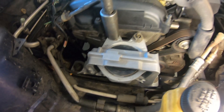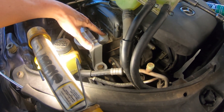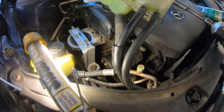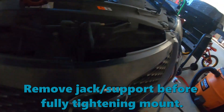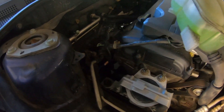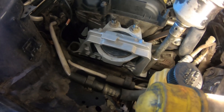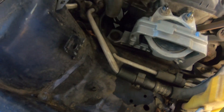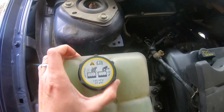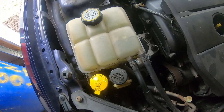Now we can tighten down these two nuts as well. When you do the front part you want to make sure these nuts are snug, or at least bottomed out. Then before we go wrenching on them we're going to remove the tension from the bottom of the engine so we're not driving it down onto our oil pan. Now we can go back in and make sure they're all tight. The final step to installing the engine mount is to reinstall the two tabs on there — just take your hand and push down firmly, and we're reinstalled.